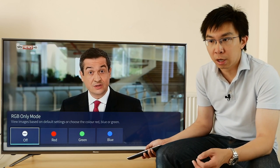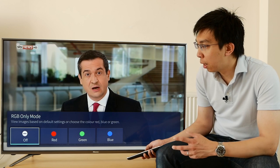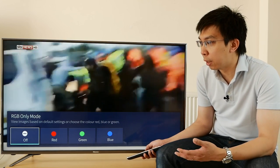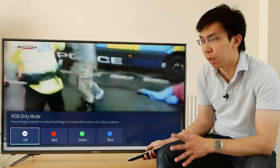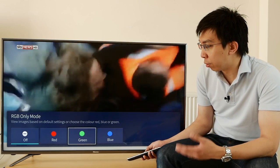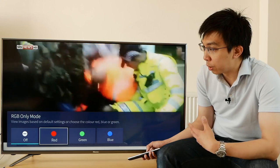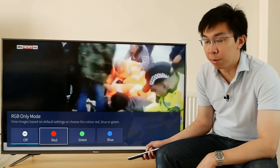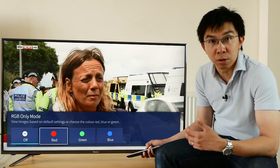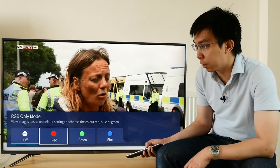Basically, in the old analog days, remember if you bought a test disc such as the Digital Video Essentials test disc that is produced by Mr. Joe Kane, you would be using a color filter to check the color decoding of your television. Now, lately, many manufacturers, I think Samsung was probably the first one to start it off on their flat panel displays, certainly in terms of flat screens, I remember seeing this first on Samsung televisions. They allow you to filter out the green and blue, or filter out the red, whatever you want to filter out, for you to check the color decoding of each individual primary color, which is much more accurate. But these days, we seldom even use it. As professional calibrators, we seldom use it because we are basing all our calibrations and adjustments on the meter, which can give you all the values of the hue, saturation and luminance errors from the meter alone, which is much more accurate than having to go through this decoding process.